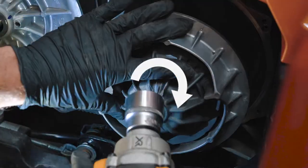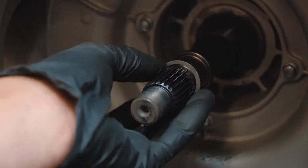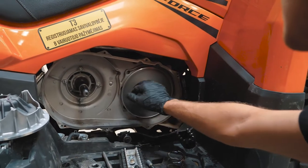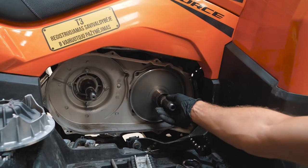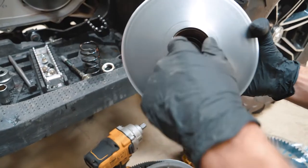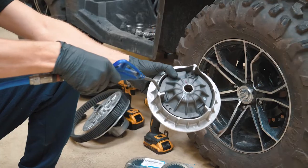Notice that the bolt and nut has left-handed threads. Do not forget the washer for adjusting the gap. Always check the one-way bearing — it has to spin freely; change it if needed. Carefully disassemble the CVT clutches and clean them with compressed air.